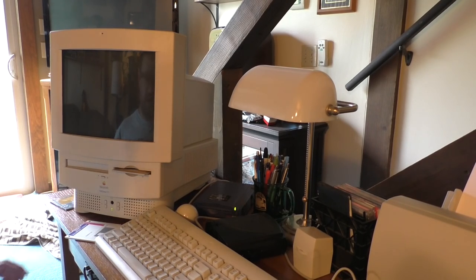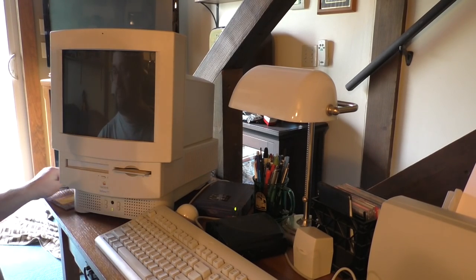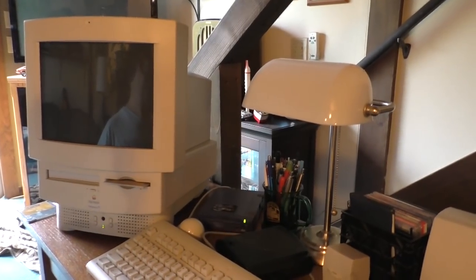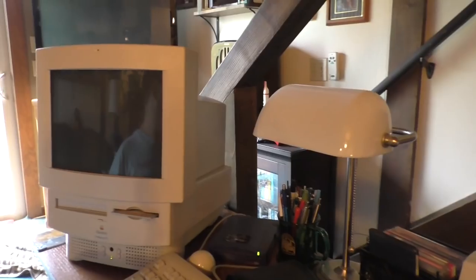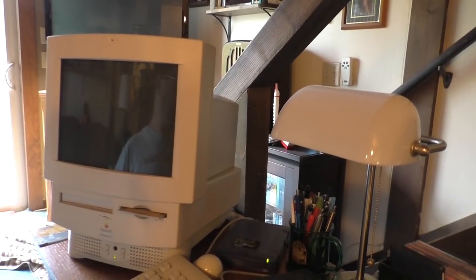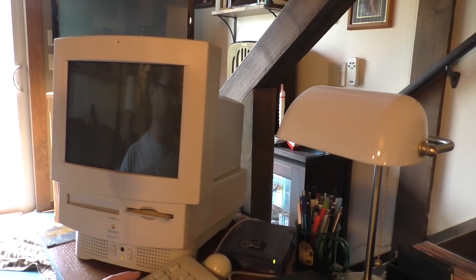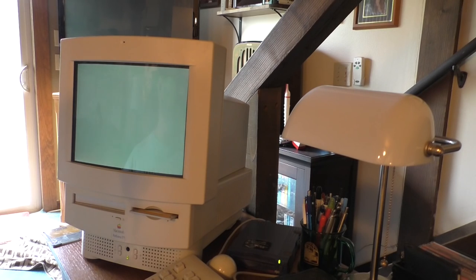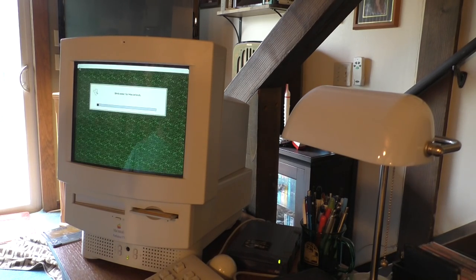I just spent a considerable amount of time working on this Mac, trying to improve the CRT's condition, and I think I did a decent job. The thing with these aging CRTs is at some point, they will need some attention, be it capacitors or drifting values in resistors in the high-voltage circuitry. This one displays a very crisp and clear image, but it wasn't easy getting it to that point.